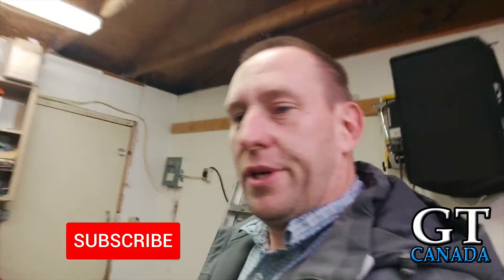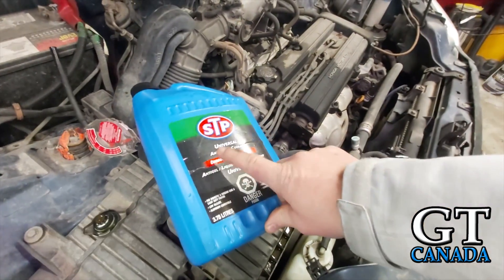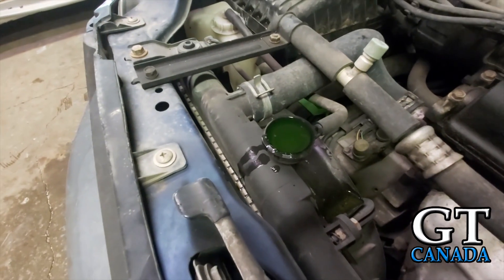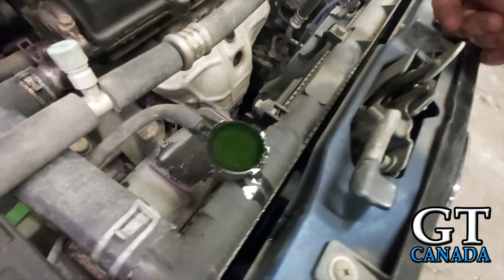What we're going to have to do is drain some of the existing coolant out and add some coolant. I've got a new coolant right here — this coolant is concentrate. You want to make sure that you buy concentrated coolant. The reason is we need to get coolant out of here and add straight coolant to the water that's already here. And if you look at the color of that, you can't judge this on the color alone. The color looks good, there's coolant in there for sure, but that color is deceiving. This is definitely a nice green color, and you just saw that even though it's green, it's still only good to about minus 12.